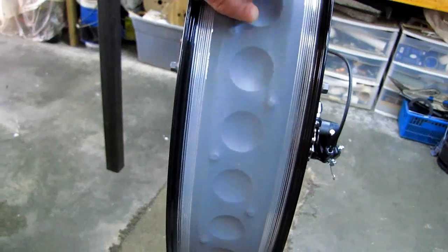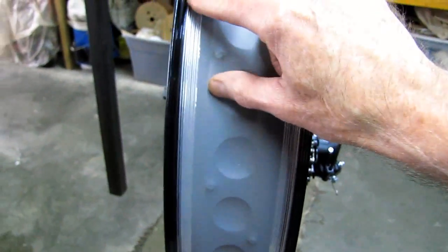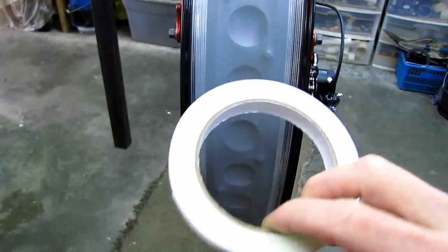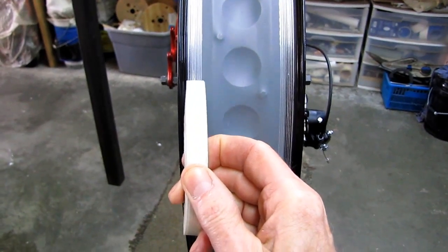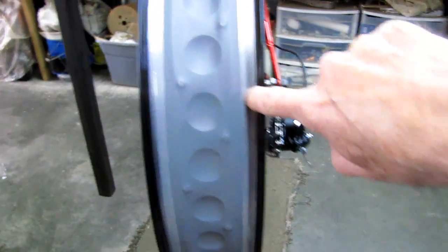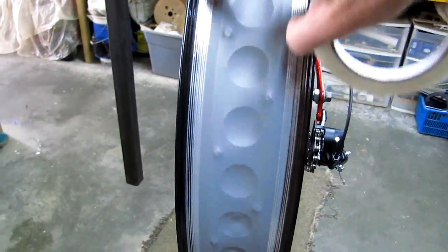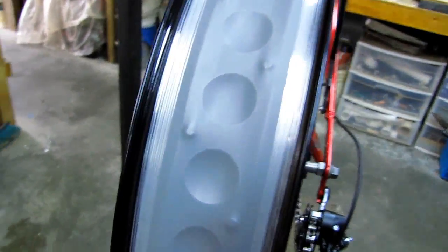You don't want your sealant to run around the edge of this rim strip. So I used half-inch wide strapping tape that has the nylon filaments in it. The reason I use that is because you can lay a real precise bead with this size tape — it's manageable. I went around two times on both sides and then pressed it down real good with my finger, no air bubbles.